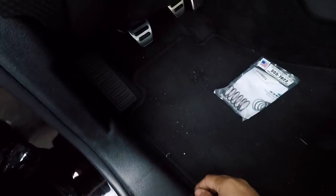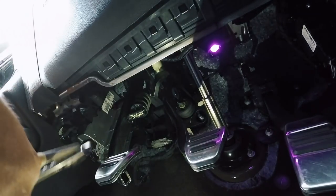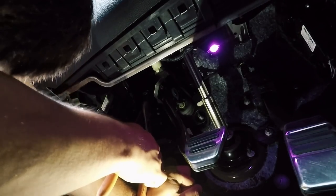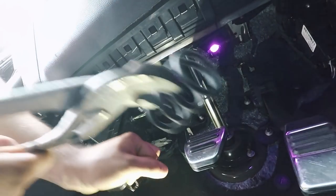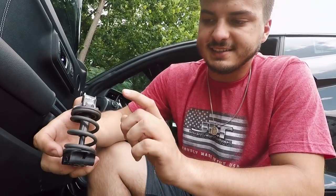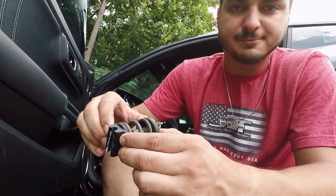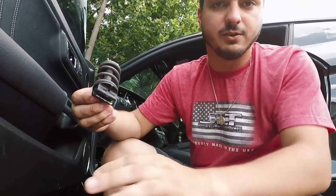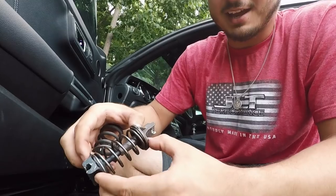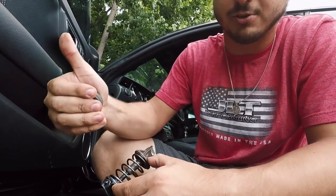This is a replacement clutch spring for this car, located right at the very top of the clutch pedal. Push down on the clutch pedal, grab the spring with some pliers, squeeze it together, and it comes off its perch real nice and easy. The top part stays still and the bottom piece is connected to the clutch pedal, so when you depress the pedal it's squeezing this spring — that's what gives you the really difficult clutch feel. The Steeda spring is a direct replacement, and you can depress it with your hand to see how much lighter it is compared to the factory OEM one.